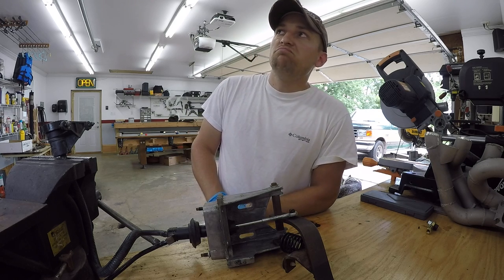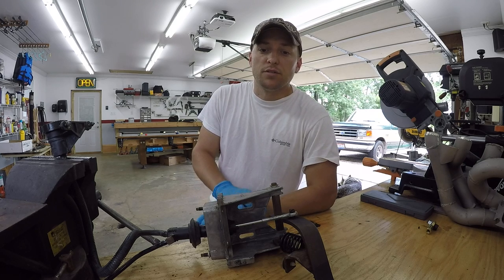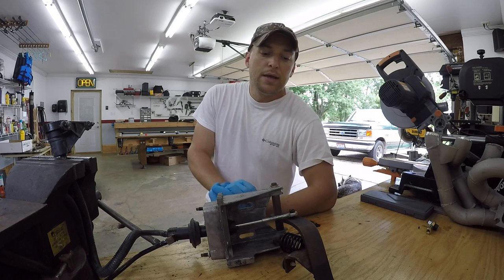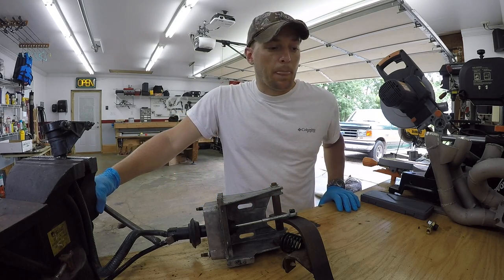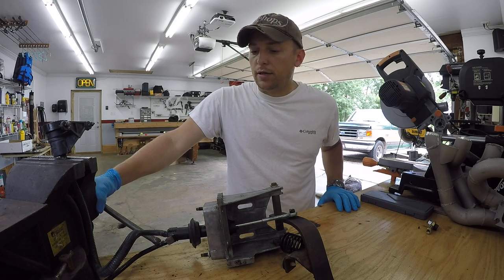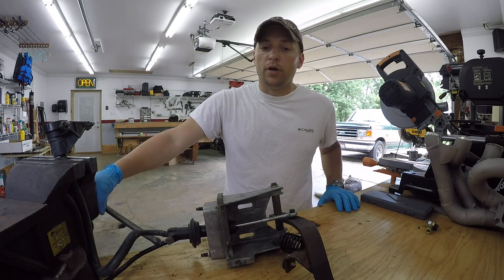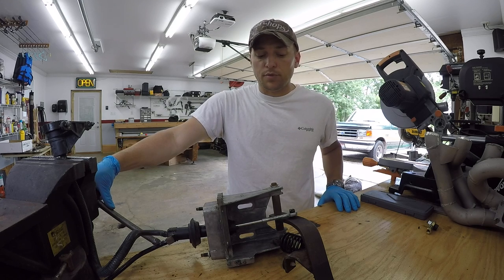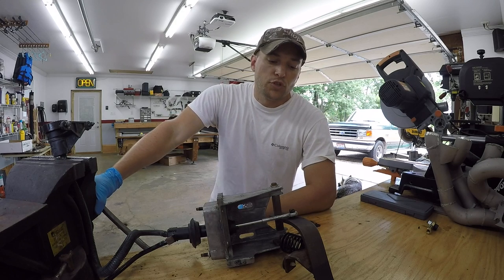But then, say three to four months later, it was back to its original place where you had to slam it on the floorboard just to be able to shift and get it in reverse, low, or first gear. I had to turn the truck completely off, put it in gear, and turn it back on, and all the other gears were really hard to shift in as well. Going on the highway, it's easier to not even use the clutch pedal and just match everything up. So it's kind of annoying to have to turn the truck off just to start moving forward.